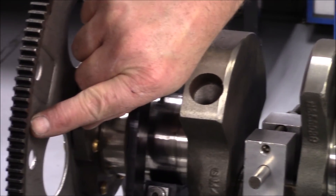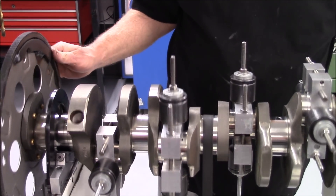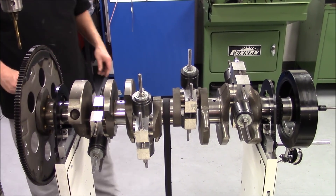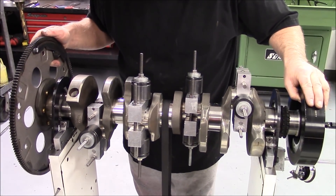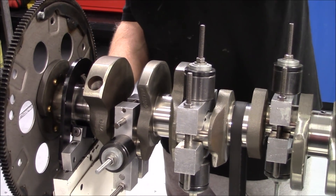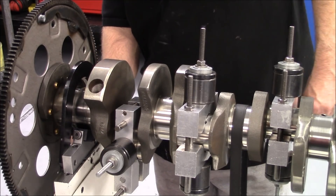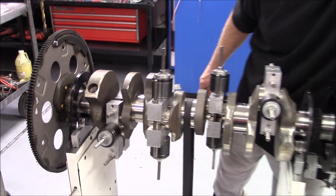So what we're going to do is we're probably going to enlarge this hole right here in the flex plate just a little bit to shift the weight this way. To see if that's going to do the job, we're going to clay it. What we're talking about is drilling this hole, so we want to go 180 degrees away from that hole and put some weight with the clay on the flex plate. I'm putting clay on the backside of the flex plate, 180 degrees from that. Let's see what it does, see if it shifts the weight.